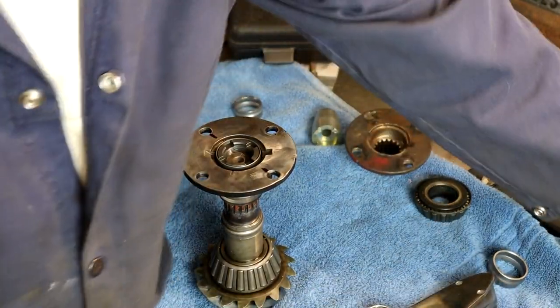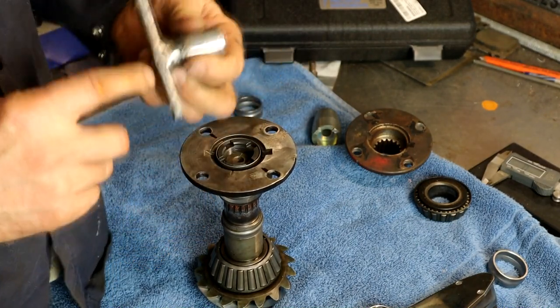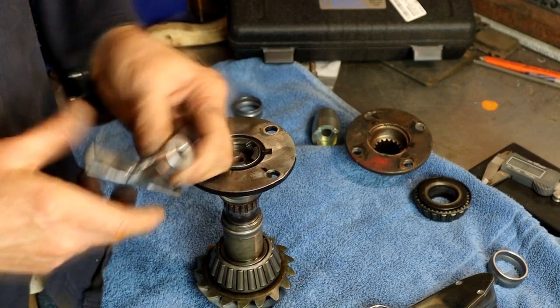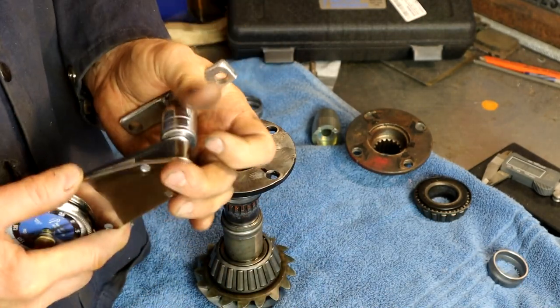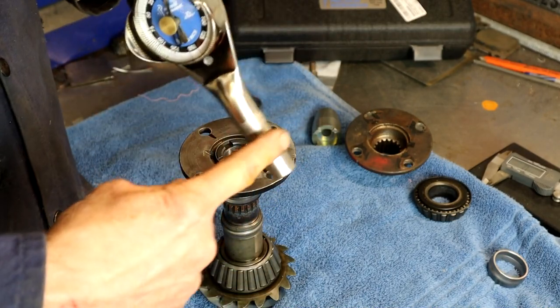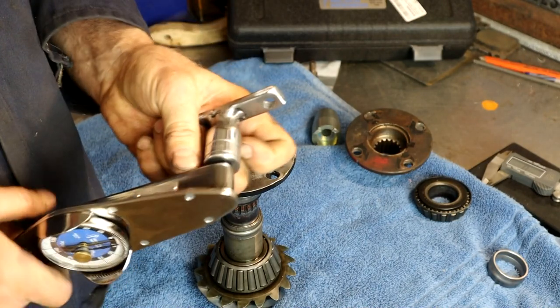What I've come up with is a plate of steel that will bolt right across here. I've got a nut welded onto this plate, and then I welded a socket on it — 3/8-inch drive. The reason I welded it is because you don't want it slopping around. All you want to do is just turn the handle to get your reading.